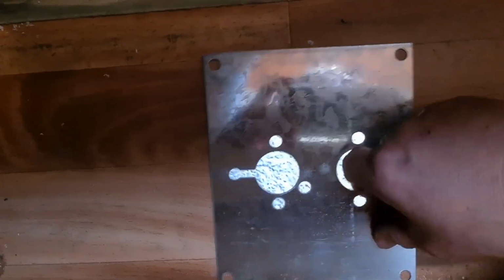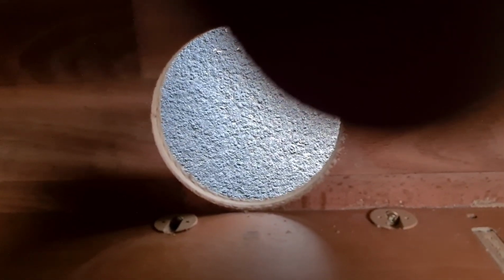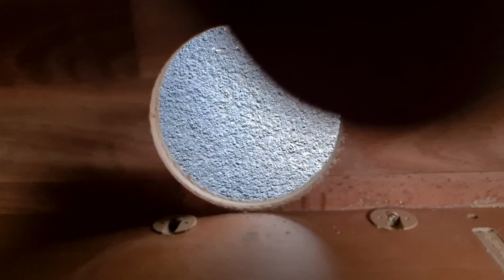So I'm going to put the heater down in here. Now, I've already cut a hole. Down in here, I've cut my hole, which actually was, let's have a look, 102mm to 127mm. So just check that. Make sure that you get in under your van and pre-drill a hole up from underneath, or even from inside, and then have a look to make sure nothing's going to be in your way when you drill through. You don't want to be drilling this hole and then figure out that there's actually a bit of chassis underneath and you've got to redo it and then try to plug up the hole.